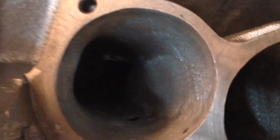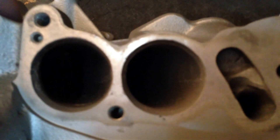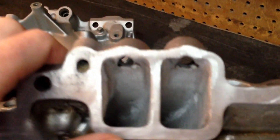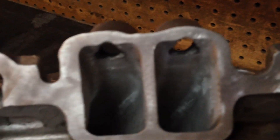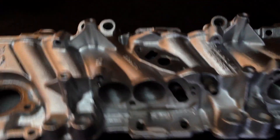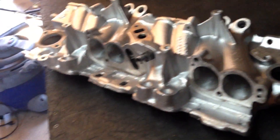The video just doesn't do it justice — these are very large ports and they flow extremely well, much much better than the unported manifold, which is so much smaller. I match it on the other side too. You can do a gasket match up to a 1205 Fel-Pro gasket; this one is basically a stock size gasket, like a 1204 or 1256. These turn out really nice and flow extremely well.